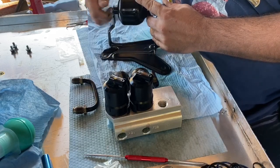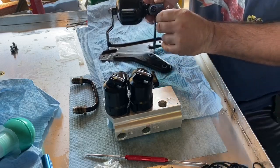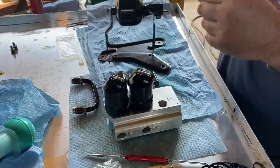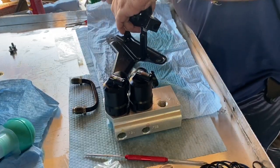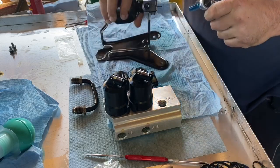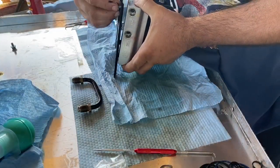10mm nut. And 10mm bolts. Pretty much this whole system, it's 10mm, 17mm. Other than the clips and stuff, and the stuff I had to take the exhaust system off, or the passenger side exhaust system, it was pretty much straightforward. 10mm, 17mm. No real special tools required. Okay. And then this thing slides up in here. Two 10mm on the bottom.